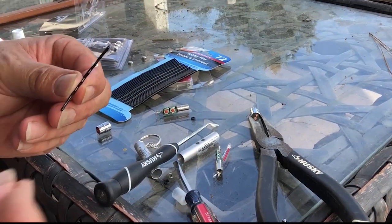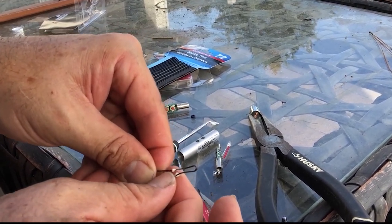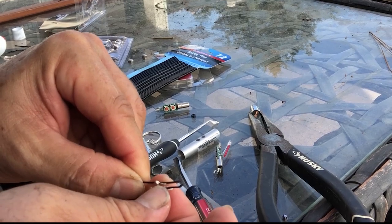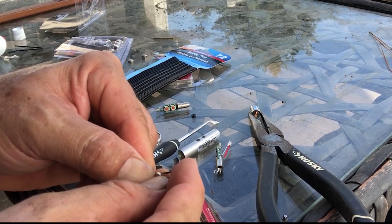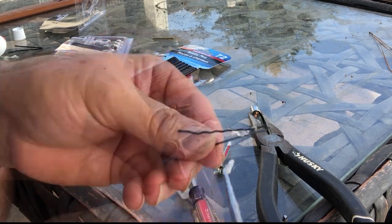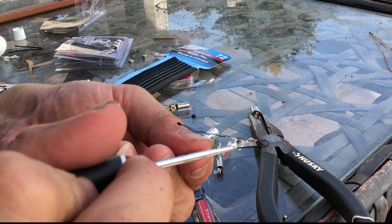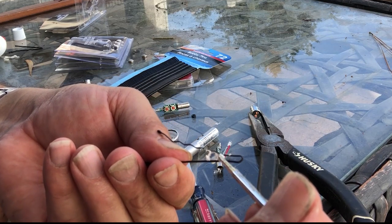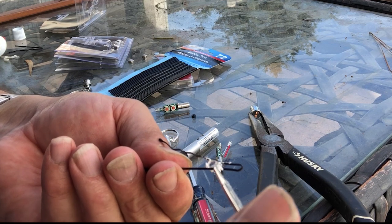Now that you have the lens, it's time to attach it to the bobby pin. This is the tricky part. I'm warning you now that this bobby pin will slingshot this lens to a place where you'll never find it. It doesn't matter where you place it within the claws of the bobby pin — this is where the glue and the toothpick are going to be used. Once you have the lens in the claws of the bobby pin, make sure you stabilize it and glue just a little bit of the edges. The higher you put the lens toward the base of the bobby pin, the higher the chance the lens will slingshot out. It just takes a little bit of glue to attach the edge of the bobby pin to the lens.